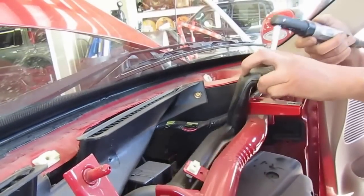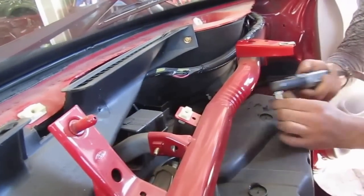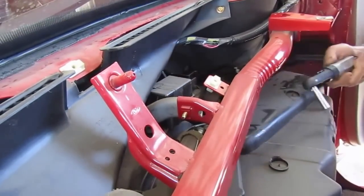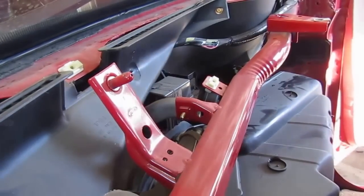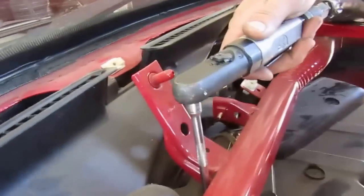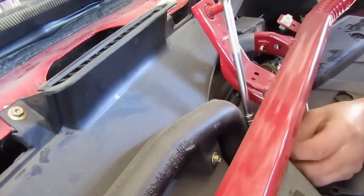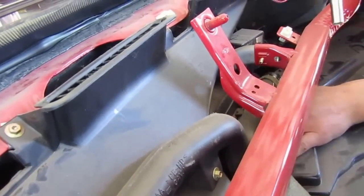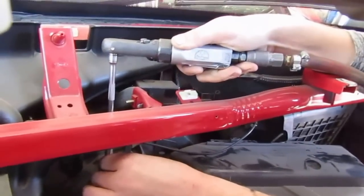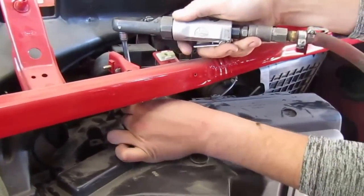You can either remove this vent right there — it'll make your life a lot easier as far as getting to all these other bolts back in here. You have to pop a little vacuum line up out of the top of your box cover so when you pull it out you don't break it — it's very very small, hard plastic, breaks very easily. Be sure to pop that loose or you will have problems.